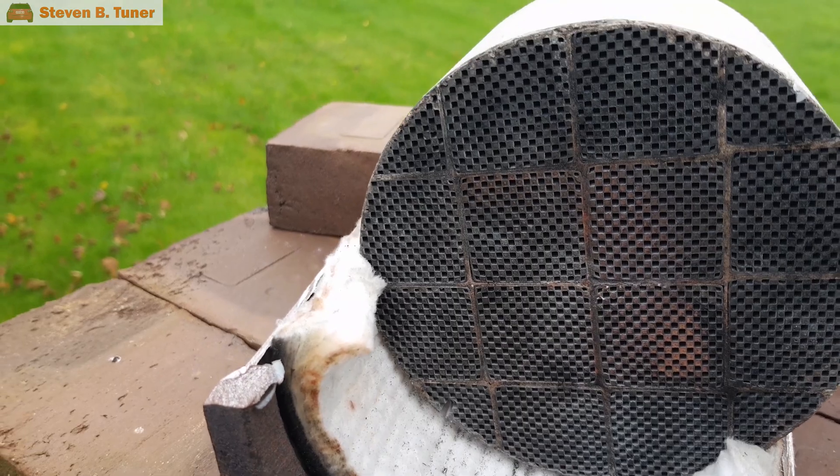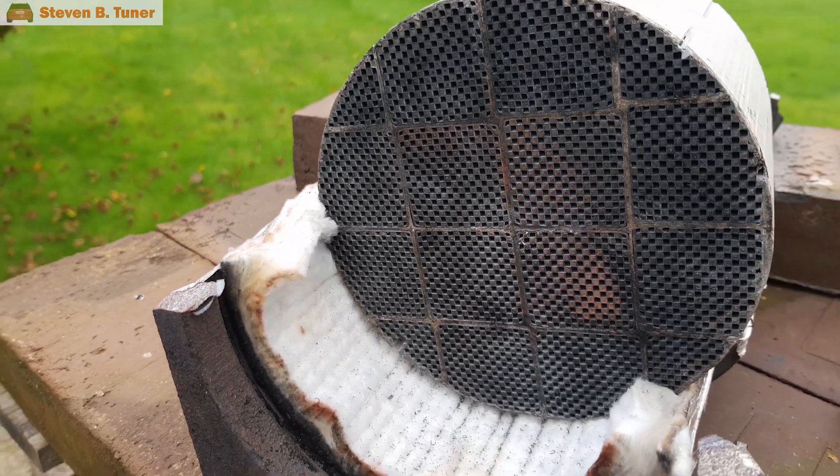The black residue is soot or oily soot, and anything with a red color is ash. Soot is supposed to burn off as a normal function of a working filter, but ash is something that builds up over the years and eventually means that the diesel particulate filter needs to be removed for cleaning. Let's see if some extreme temperature will remove both soot and ash.